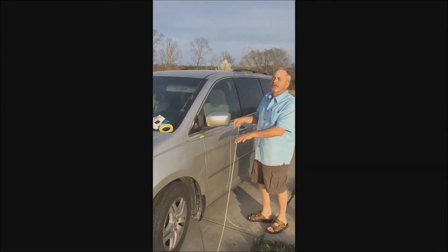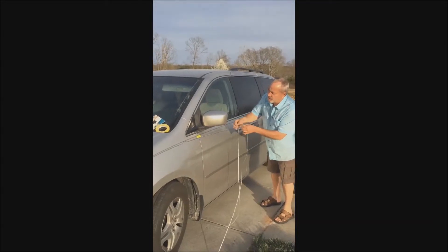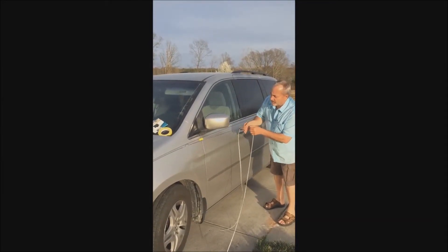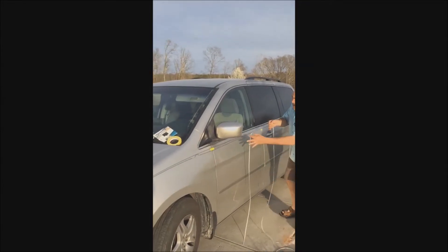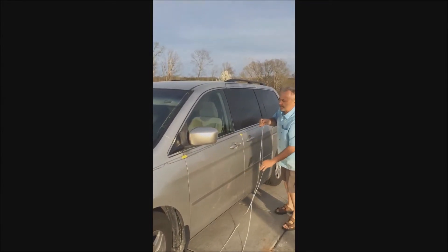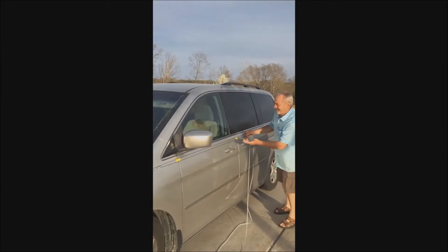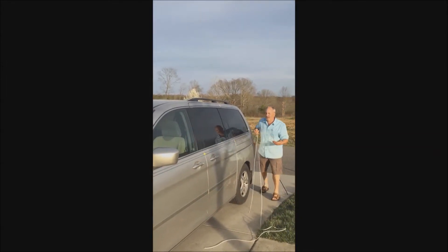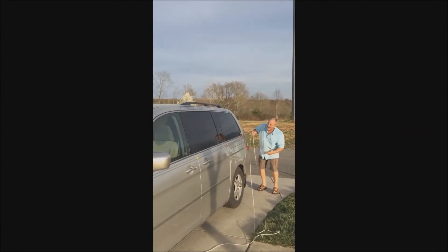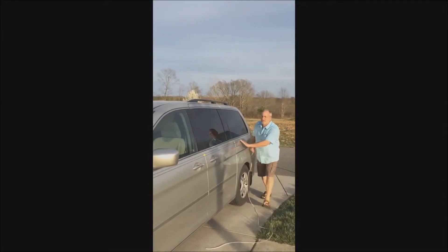Some of these manufacturers' panels are jogged. What you do is you don't want to hold on where there's glue — you want to hold on where there's paper. So you come back, pull some paper, come back, pull some paper. Now you can string this one line, one panel at a time if you want. Typically we go a couple of panels — it's just a little bit of a straighter line. We come back, lay it out like so, come down and press it.